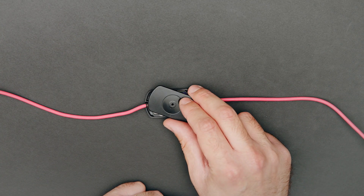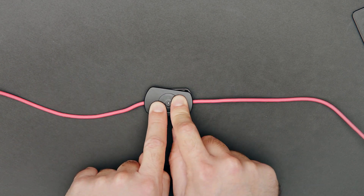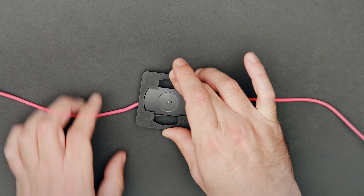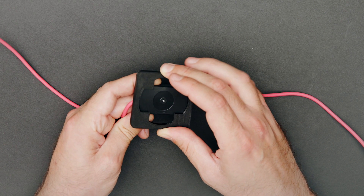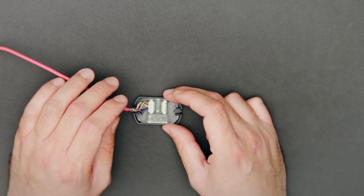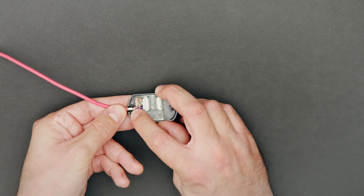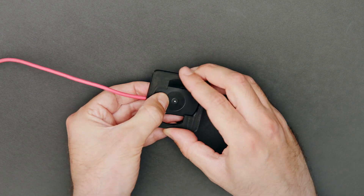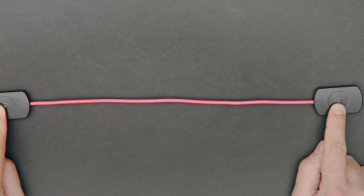To get the lid back on, place it back on the sensor at a bit of an angle and you should hear a click when it's on. Then place the sensor tool back onto the lid and this time turn counterclockwise. You'll know the sensor is properly closed if there is that satisfying click. Do the same thing for the other side — this can be a bit tricky. While you should try to be gentle, the sensors are fairly robust and you do want to make sure the lid is firmly closed. And there we go — we have now replaced a faulty cable.